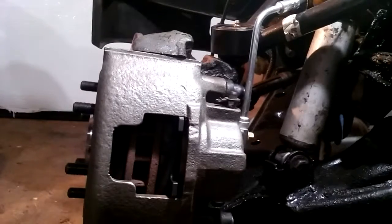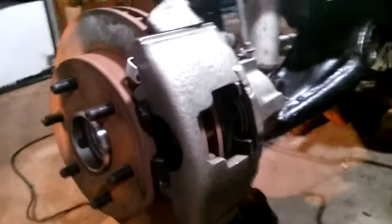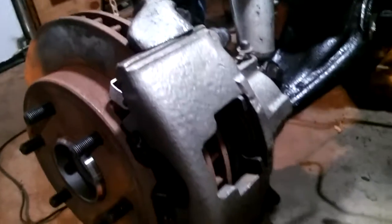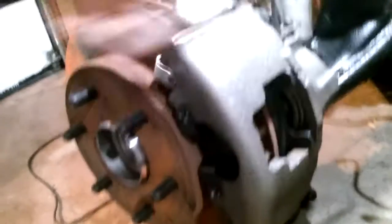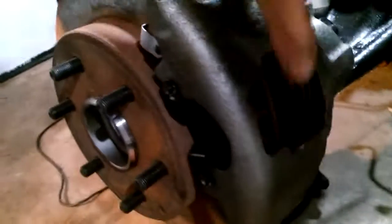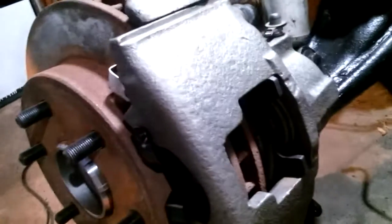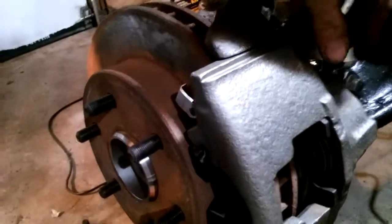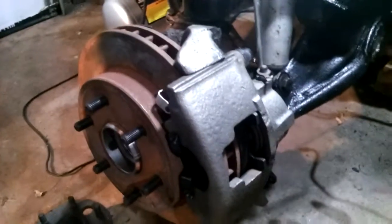So this is how to put a brake caliper on a Chevy pickup truck, or take it off. To take it off: loosen the pins, pop it loose with a hammer, pop the pads off, use the C-clamp to compress the worn-out pad so it pushes the caliper back, and put it on. Always use new fluid, never the old. Put the cap on to keep the dirt and dust out. Hopefully that helps you.